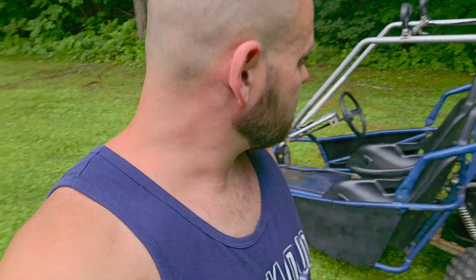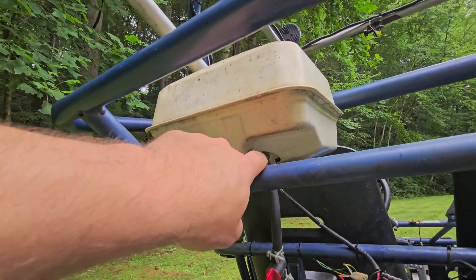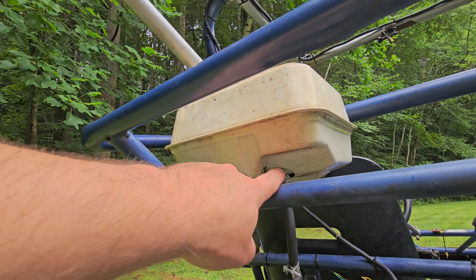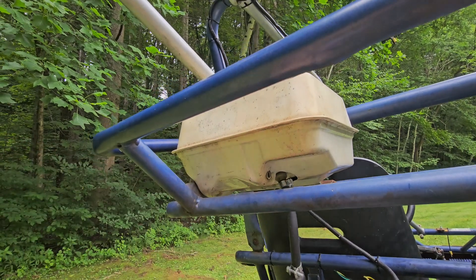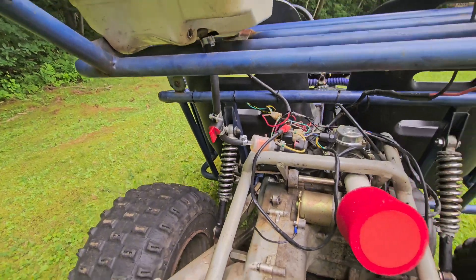What we ended up finding, like a year or so ago, was pretty embarrassing — there was crap inside the fuel tank. There used to be some kind of little pre-filter right here and that disintegrated, so I wasn't getting enough fuel. It would kind of run on starting fluid but wouldn't stay running. We ended up cleaning the carb, redoing the fuel lines, fixing that tank issue, and then raced it for quite a few months after that.